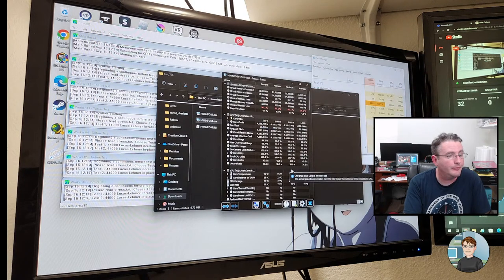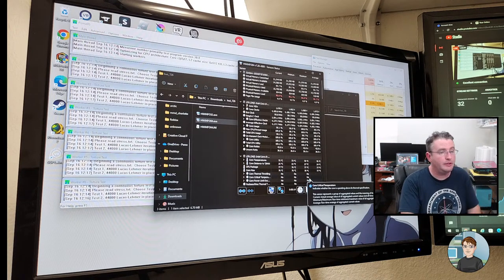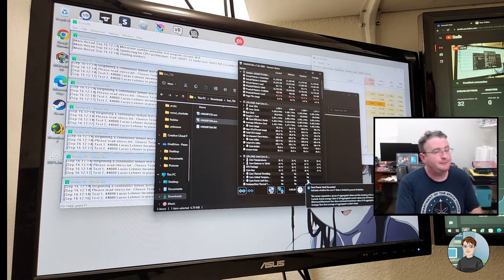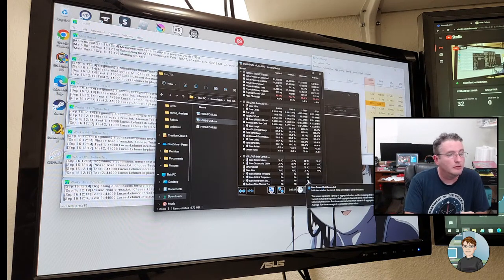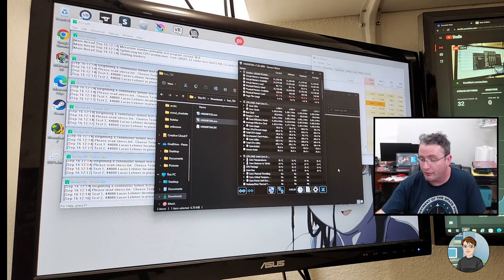There we go. Okay. And we are at 76 degrees Celsius. So that's with AVX turned off. Yeah. Okay, that's good. It doesn't look like it's going to go up into the 80s again, and almost certainly not 90s. But we're checking for stability, to see if it's going to blue screen again. And right now we don't have the RAM overclocked. It's running at 2400 megahertz. We'd like to get it to run at 3600 megahertz.